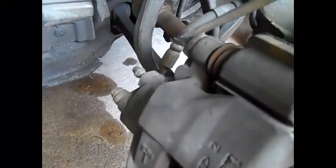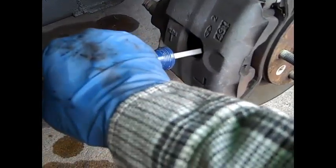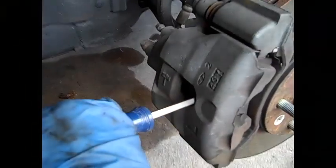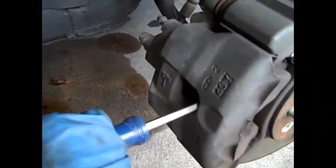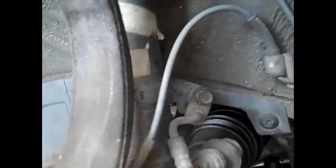Now I've got the bolt undone and pulled out enough to remove. Then I took a screwdriver and kind of put it down there against the rotor and pulled. What I'm doing there when I'm pulling is pushing against the caliper, squishing the piston into it. That kind of releases its hold on the pads, so then it allows the caliper to slide up. Then I've got a little bit of resistance.